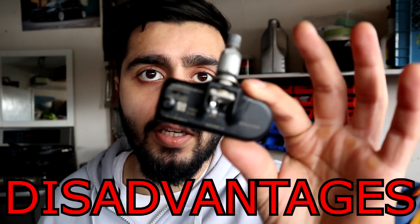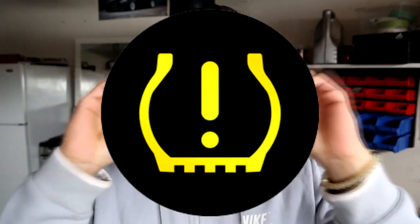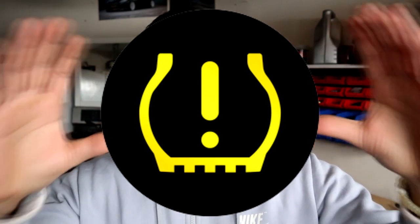It's good to know that when a tire pressure light appears on your dash, it can appear in two different ways. The first one is where it's blinking and flashing — that represents a miscommunication in the system. It's not able to communicate properly, maybe a sensor-related issue, but it does not have to be directly tire-pressure related.